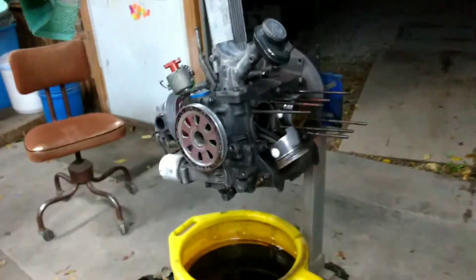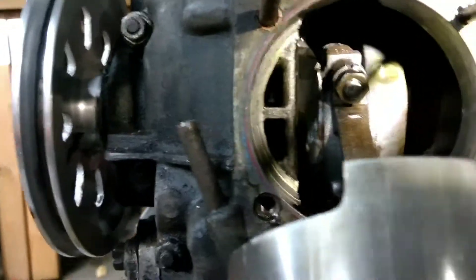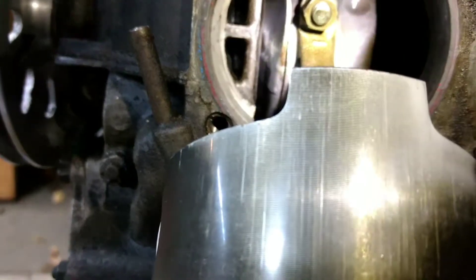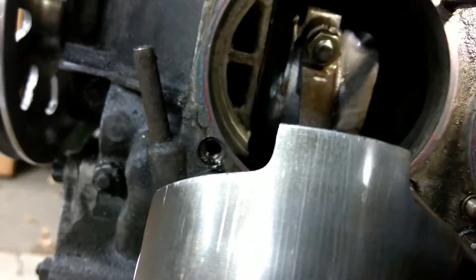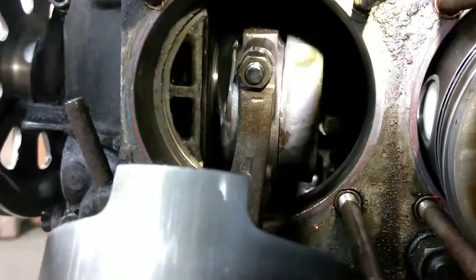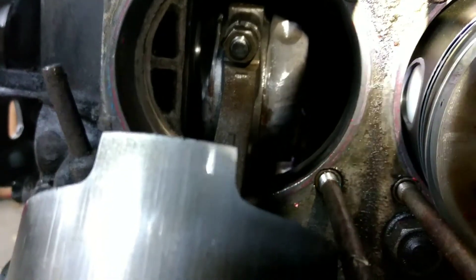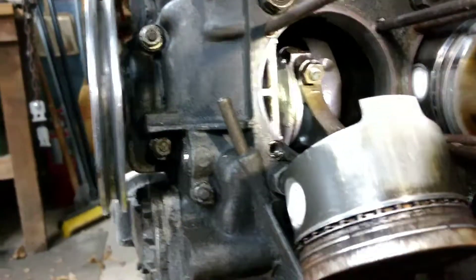Let me see if I can look in here. It looks to be a German crankshaft. Let me get used to where my camera is at. I don't know if you can see it or not on that one - you can see it on number one, just to the right side. Let me turn my flashlight down so it's not so bright. You can see a little bit of weld right there next to the rod. My guess is it's a German crankshaft that's been welded and reground, so I don't know if it's got a stock stroke or not - that'll be my next process.